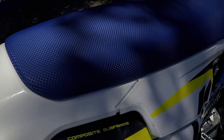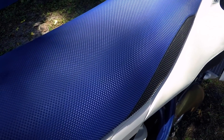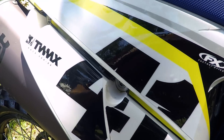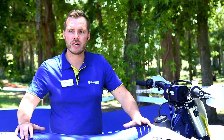We've also changed the rigidity of the subframe, stiffening it up a little bit more on the rear. We found it was flexing too much when it was really muddy or in extreme conditions. We also changed the whole design to a new two-piece design, which managed to save 250 grams of weight by reducing the total size of the subframe.